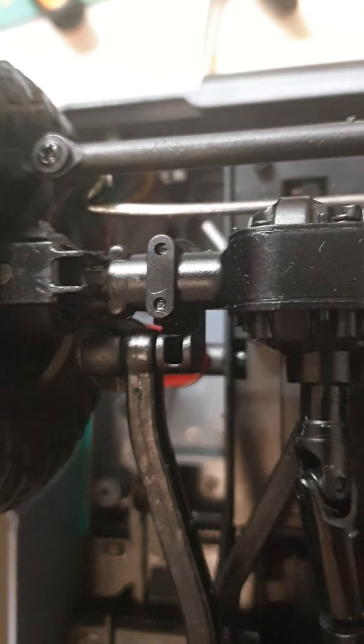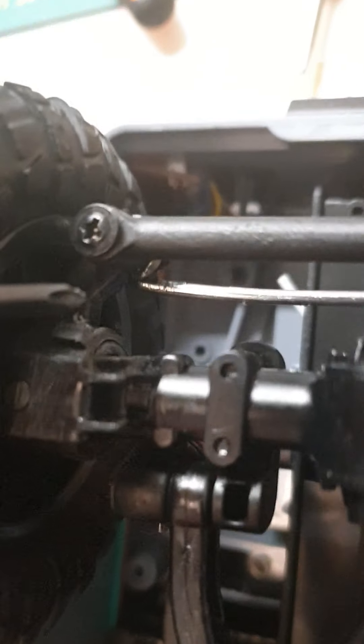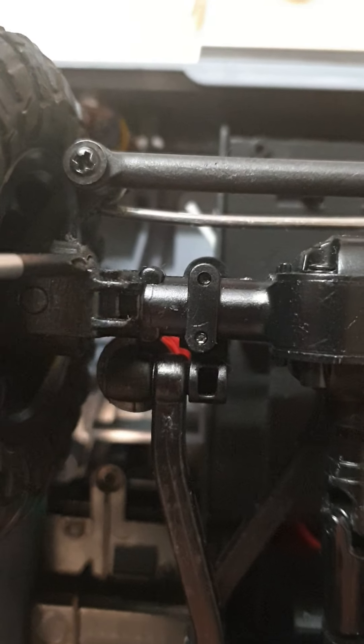I also put a little bit of grease here so it slides well. The last thing I did — because this removed some of the bump steer but it didn't allow me to turn the wheels further out — so I filed this part a bit inwards.